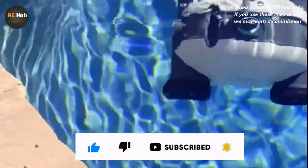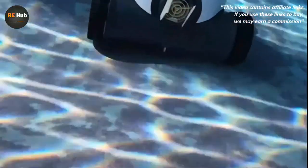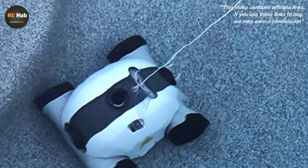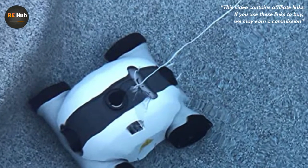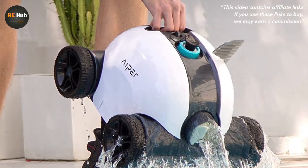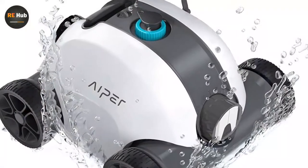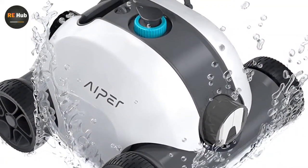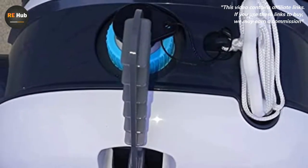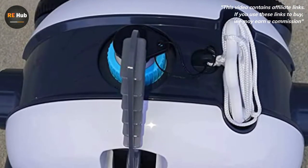The handle pivots up and can lay all the way over to the front. The large size also doubles as ballast as it climbs walls. Down below you can see the PVC brushes along with softer smooth tracks that provide propulsion, while the vacuum pulls the robot against the floor or walls through two rectangular ports near the center. The clear belts on the left and right provide the drive and can operate individually, allowing the robot to turn in place. Inside are two debris baskets that catch everything vacuumed from the bottom of your pool — both are the same but asymmetric and must be placed in a specific orientation.